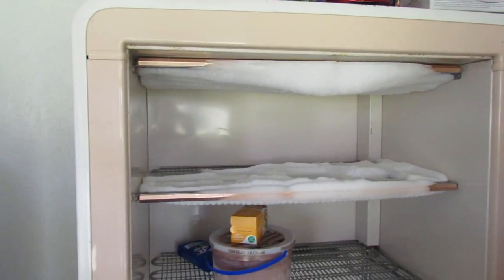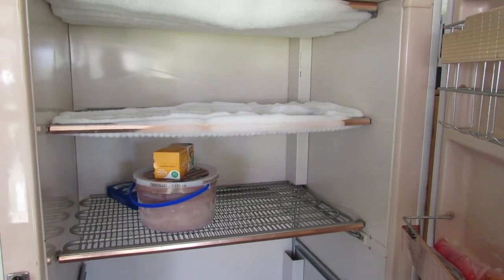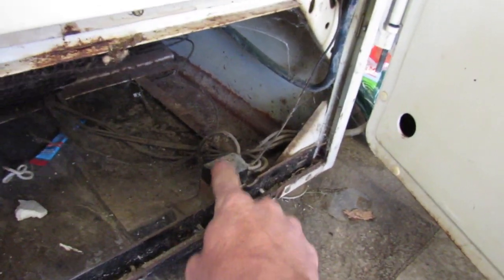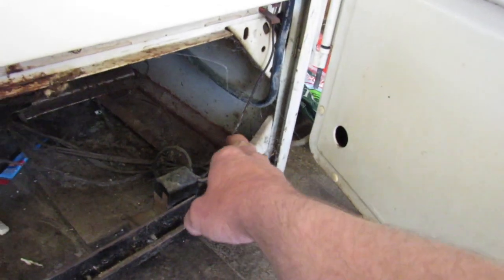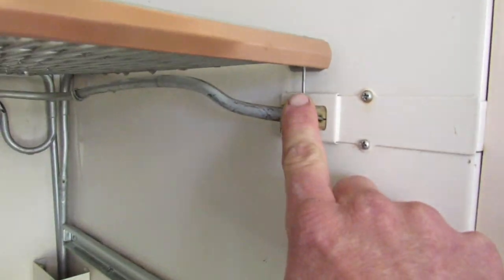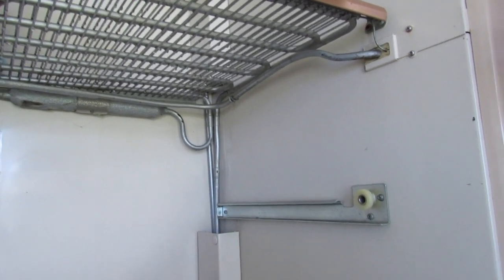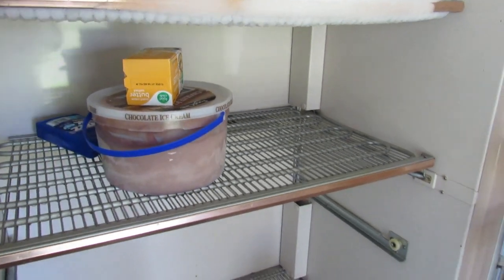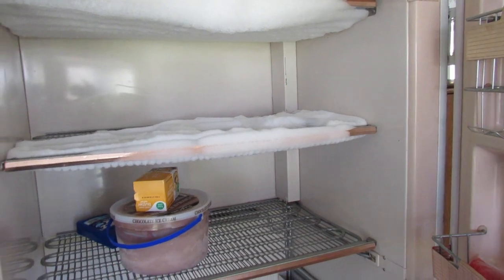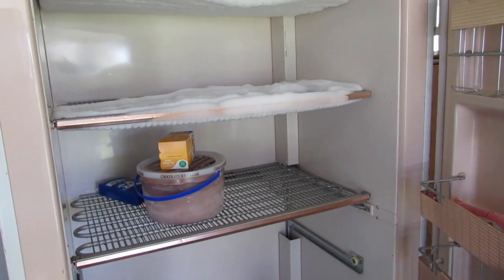The freezer has no controls — no knobs, no on/off switch. These old freezers were preset from the factory. This little unit down here in the corner is actually your thermostat, and the capillary runs up through behind the cover and goes into a tube snapped to the shelf. The problem is my freezer is getting too cold. I noticed several months ago it seemed like it was running an awful lot, and it's actually running long enough that it froze solid 80-proof whiskey. So we've got to replace the thermostat.